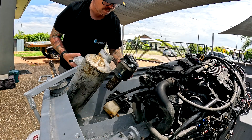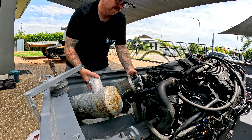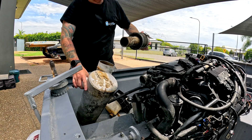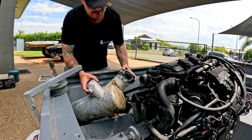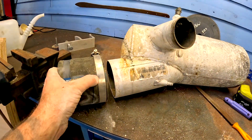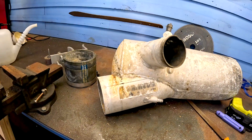Quick test fit. If we get it down further - oh, we're so close. Not quite close enough. Really, I should be able to go until it's right up there and then the rubber just covers it. The amount I leave on here only needs to be as wide as that hose clamp. We're going to take another 10 or 15mm off and see how that looks.